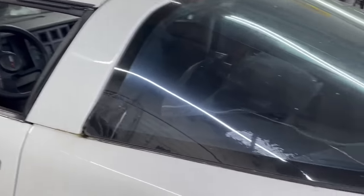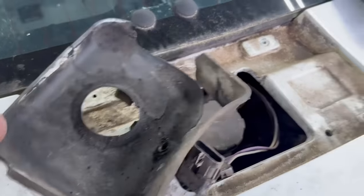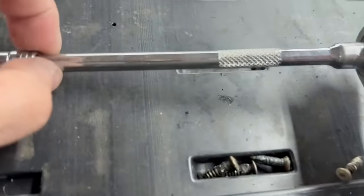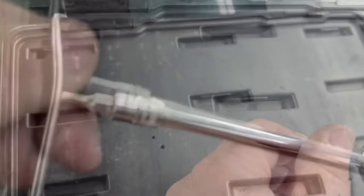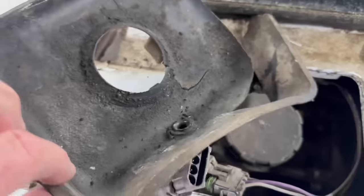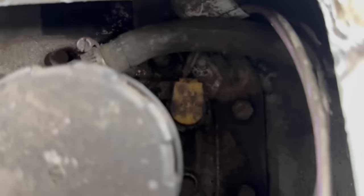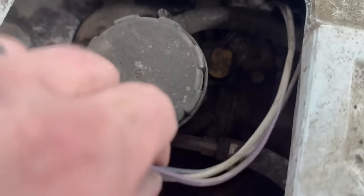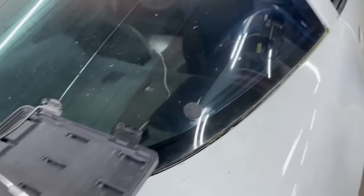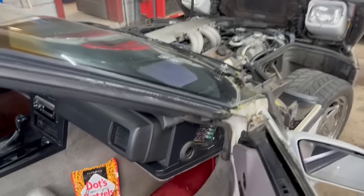Changing the fuel pump on this is actually one of the easier things to do. There are four very small Torx 15 bolts back here — once you unscrew those, that whole piece comes out. Then you have to fish the assembly out, making sure you get all the dirt and debris out of it. This is the fuel pump assembly down in here. We were also thinking maybe we dislodged some wiring under the hood while we were working up there.